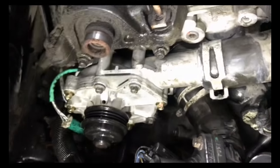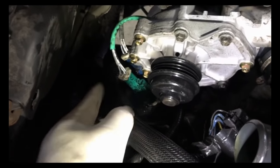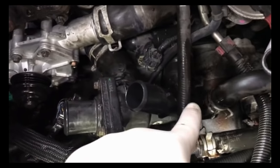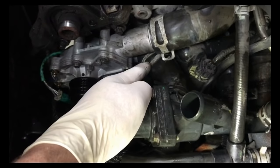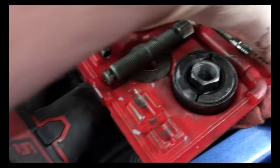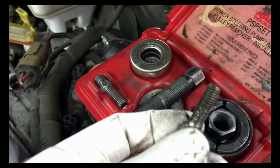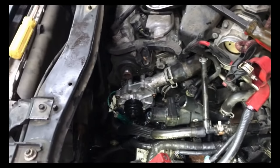Here's the pump back in place. The oxygen sensor wires here go on the other side of this hose, so you have to unplug those two oxygen sensor wires to get the pump out. You have to basically take the thermostat out to get to this hose and then take this hose off. Then it's this bolt, this bolt, and that bolt — that's what holds the water pump to the face. I have a good old-style Matco power steering pulley installer and this is the right thread that screws into the cam. So we'll get that up next.